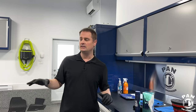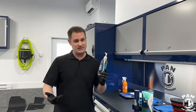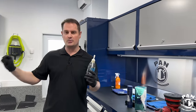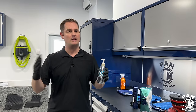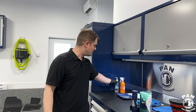For prep, I first washed the vehicle with a pH-neutral shampoo, but noticed it wasn't enough to remove the muck, grime, and embedded brake dust from the winter. So the next wash I used Gion Restart Wash — a decon shampoo with better degreasing properties and a built-in iron remover to pull out brake dust and iron particles. Use 10 to 20 mils in a bucket with 10 to 15 liters of water — roughly an ounce per three to four gallons. It also helped begin restoring some hydrophobic properties, which is why they call it Restart.